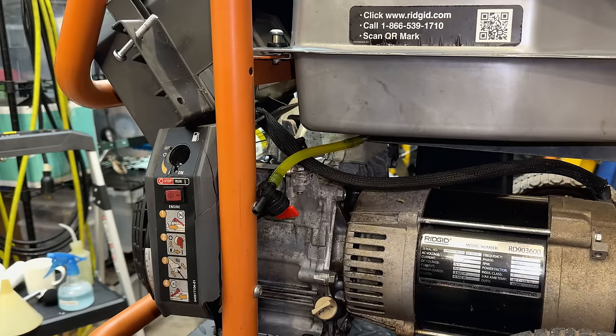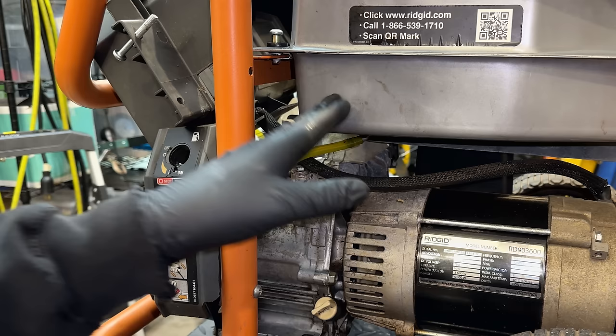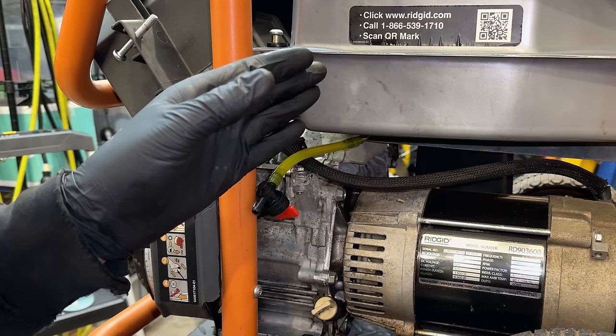So I've got the tank on there loosely at the moment. I want to get fuel in the tank as soon as possible. Since this tank has rusted in the past, it's more prone to rusting when dry, like it is right now. So either the tank needs to be coated, the problem ignored, or keep it full of fresh fuel to prevent it from rusting up again.